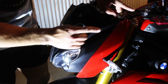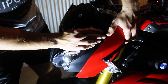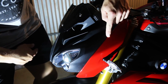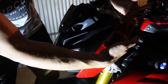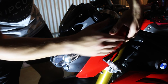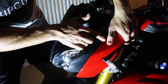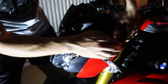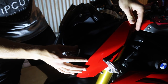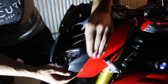First, what we're going to do is pull this outwards — you're going to sort of roll it a little bit. Basically there's a locking stud here and it's plastic, so you don't want to snap it. It locks into that, so you want to edge this forward a little bit, rotate it this way — just like that — and it helps assist the sliding. You just work it a little bit, you can feel it click. It doesn't feel great, but there we go — it's unhinged.